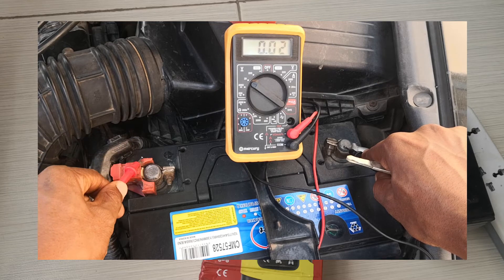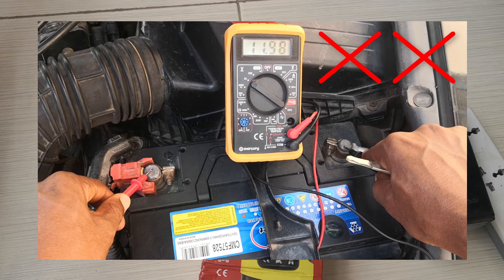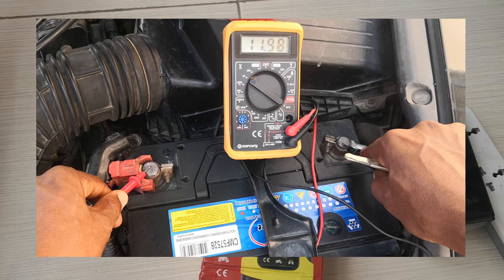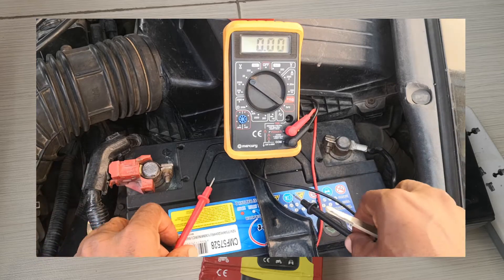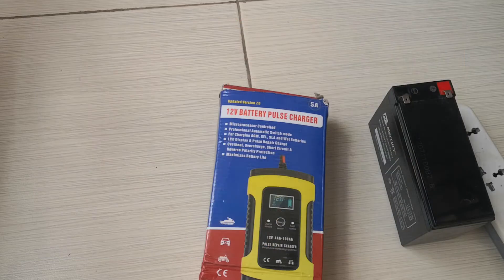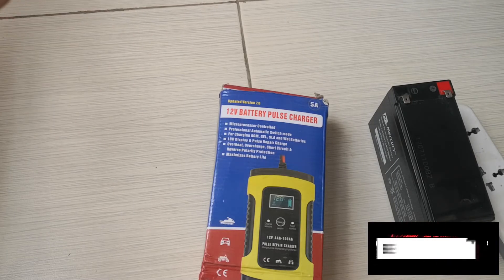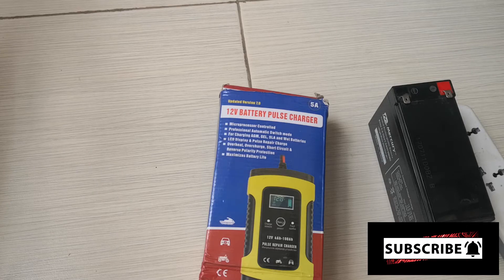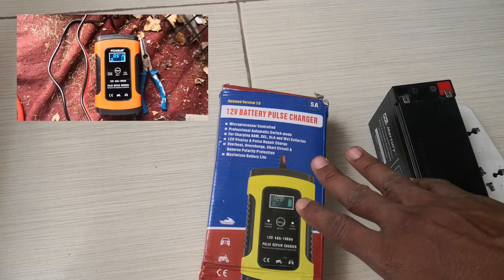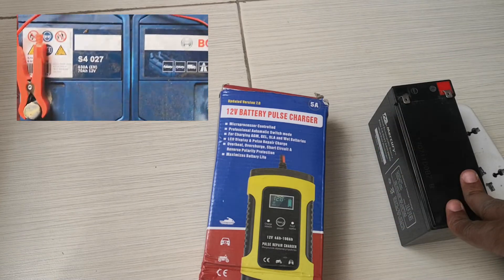What that means is most of the electrolytes gravitate to the bottom of the battery, and because of the heavy concentration of electrolytes, that leads to the crystallization process to form lead sulfate crystals. In essence, the upper parts of the battery plates are the only working portions; the lower parts become sulfated and do not properly receive a charge. With sulfation, it reaches a point where the battery fails prematurely. So in times like this where there's restricted movement, I've started taking my battery out of the car once in a while and giving it a full charge with this — that should improve the longevity of batteries.